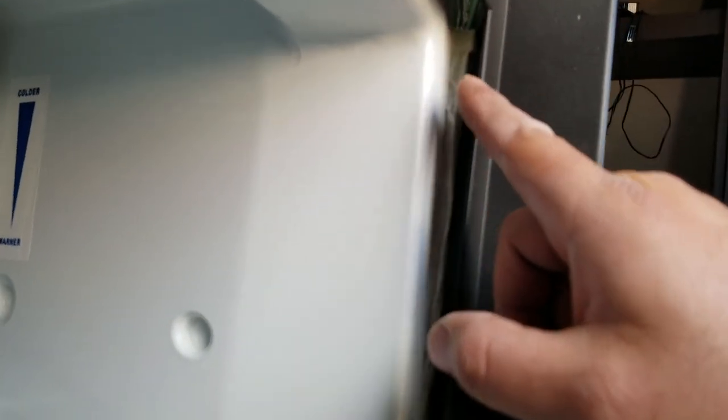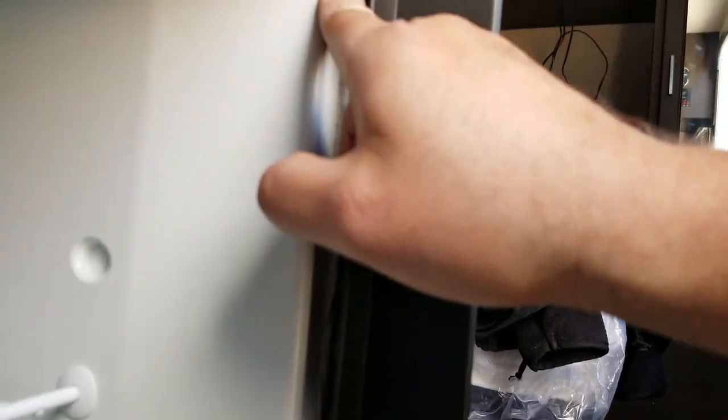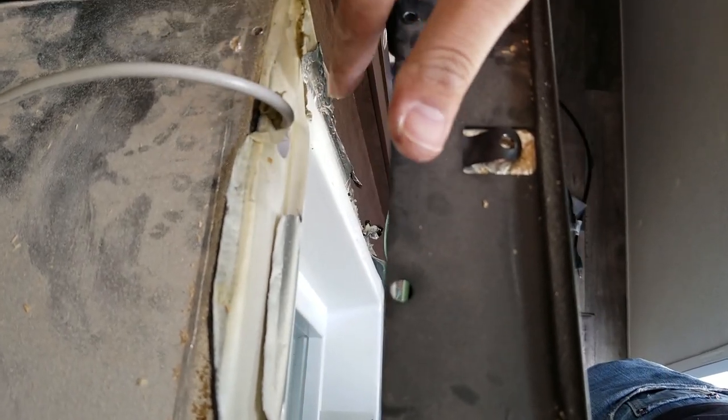I found there is some wiring going through on the right side of the refrigerator that goes to the control panel up top. I have it removed right now but I need to be extra careful not to tear that wire — there are two or three wires, greenish in color. That cable goes around the freezer, so I'm assuming it's some kind of sensor or heating element. It's clipped and taped on, so I'll carefully remove it and use aluminum tape to put it back.